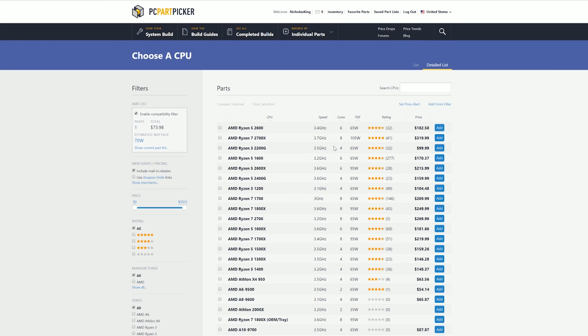If you're looking to make sure everything's compatible, go over to PC Part Picker and check that out because it'll do that for you. And once you've got the correct motherboard for your CPU, we need to look into RAM, because every motherboard supports a different amount of RAM. Your options here are basically 32GB of RAM and 64GB of RAM. If you want to know exactly how much RAM you need for a gaming PC, you can check out the video linked at the top of the screen — it'll walk you through RAM and gaming PCs. It's a great video, one of the favorites I've done in this series of how to pick your own PC parts.